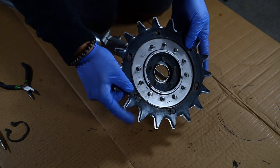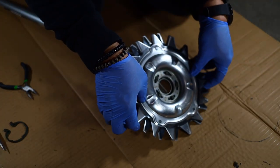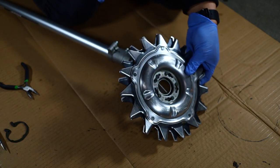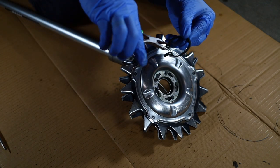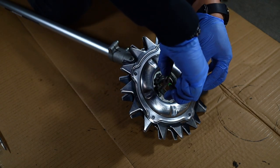Go ahead and place the upper blade through the bigger holes and twist to lock it in place. Place the lower blade on the lower disc, twisting it into place and putting it on top of the upper blade. Using your needle-nose pliers, pinch the disc bracket and place it back onto the bottom disc, ensuring it is locked in.